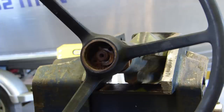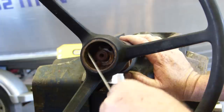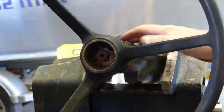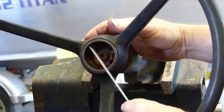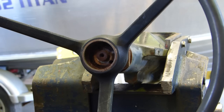Experience shows me that this is pot metal - I call it muck metal, it's just junk. Most times you try to get the tool down in there, screw the threads in, put a little bit of pressure on, and the threads pull because they're not protected. This had no cap on the steering wheel anymore. If it had a cap it may be a different job, but I reckon this one will be hard to get out. We might put a little puller - a little flying saucer or something - in behind there to pop the steering wheel off.